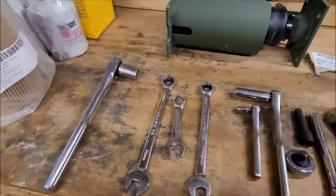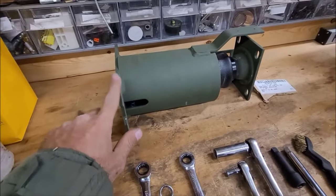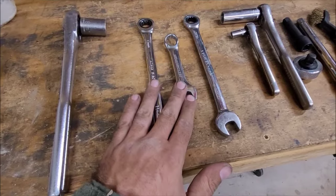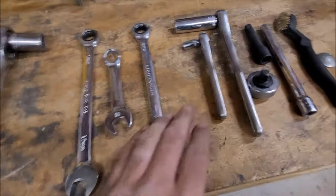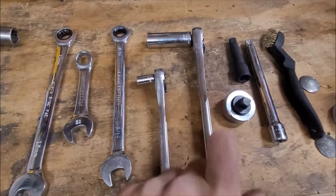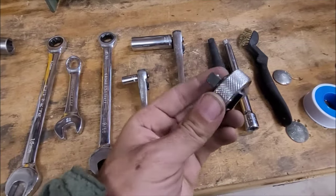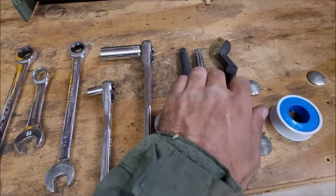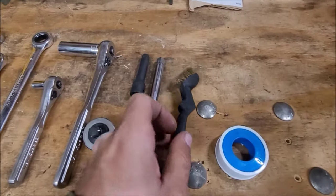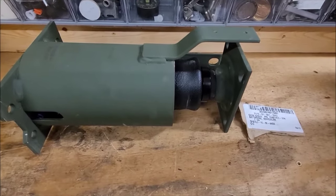Here's what you need for tools. I need an 18 millimeter to switch around a left to a right — you may not need that. 15 millimeter. Also, a stubby 15 millimeter is going to make life way better. 9/16ths. I have a 5/16ths small ratchet. 15 millimeter deep socket. And then I had two extensions — if you only have one it will probably still work okay. I also used a finger ratchet. Brass. A little brush or something — that's going to be to clean up the threads on the brass fittings. Teflon tape for sealing up the brass fittings.